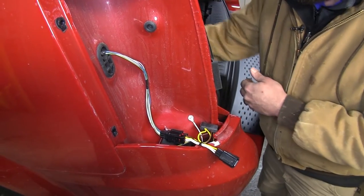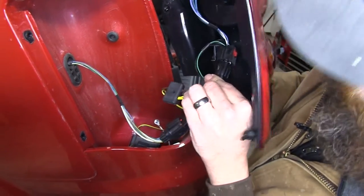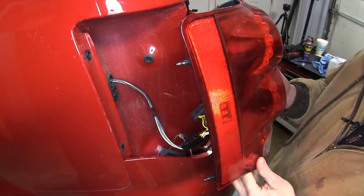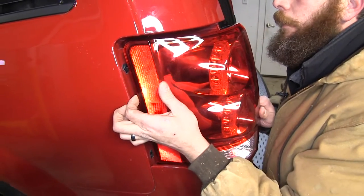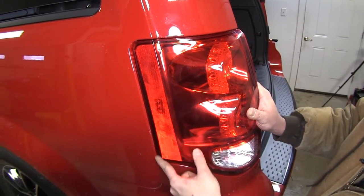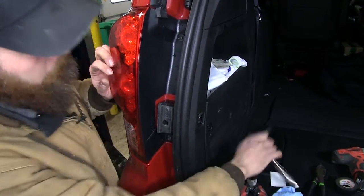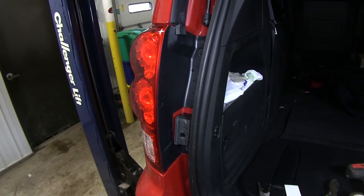Now that we've got that taken care of let's get our assembly back together. Take the end of that T-connector — it's going to get slid right back into the very first connection we separated. Listen for that click, then push that tab down to get it right back into its factory locked position. Line up our two pressure fittings, and with a good firm push in you'll see that seam come together nicely. Reinstall our two bolts holding the assembly in place, applying just a little torque. Now let's take care of the passenger side.